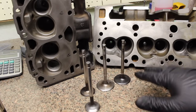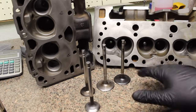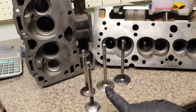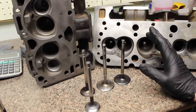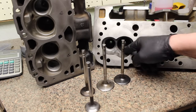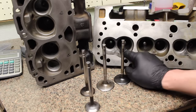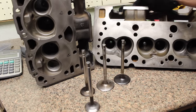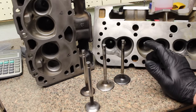Does it have a negative effect? Does it do nothing? That's why I flow tested a stock 906 head with 2.02 intake and 1.6 exhaust valves versus a stock 906 with no porting — just the regular 1.94 and 1.5. The 202-valve head also had the bowl properly blended into the seat for a proper transition, because if you cut a bigger seat in without blending, the step will be even bigger than stock. But no other porting was done — the guide wasn't reduced, the runner interior wasn't changed. I threw them on the flow bench and here are the results.